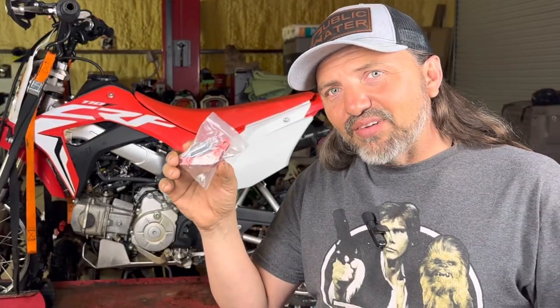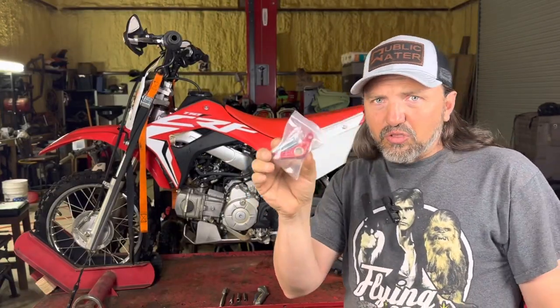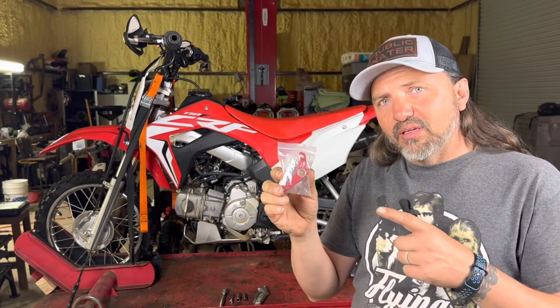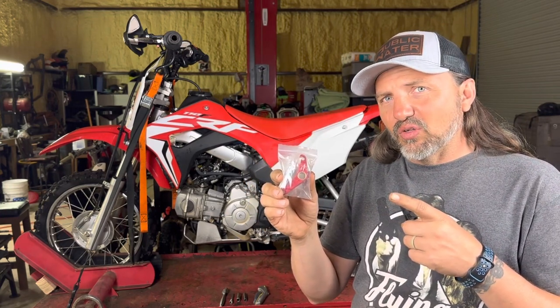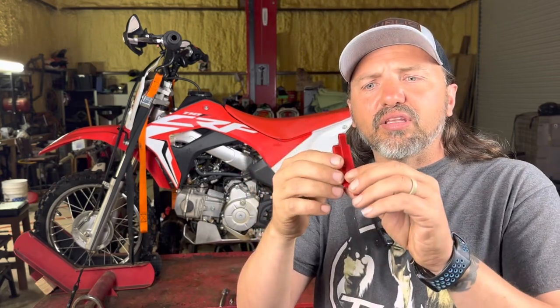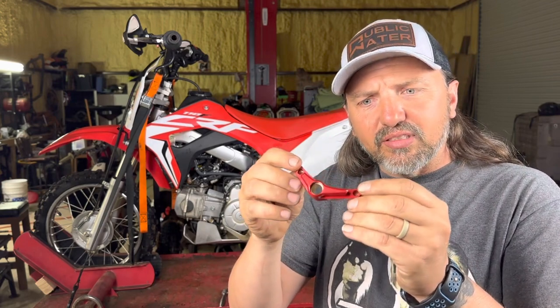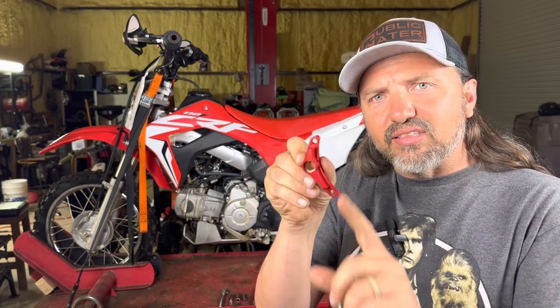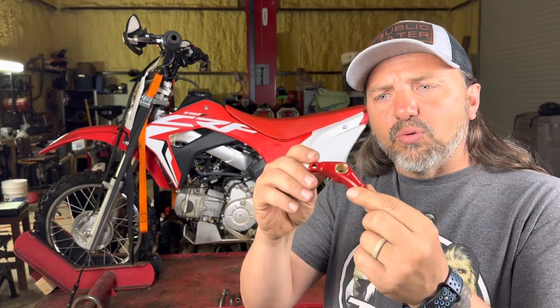In this little bag, I have got the answer to this problem. This is what you get, and not only does it come in a small little package, but it is a big help. The shift shaft goes right through the middle of this. This one has the bronze bushing in there — that's just gonna help it not bind up and not hang. It is machined out of a piece of billet aluminum, and this design on the back fits in tight around the cases, so it gives it that added extra support.